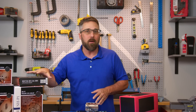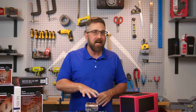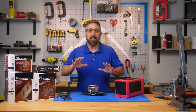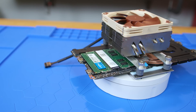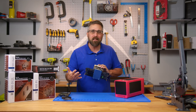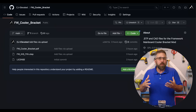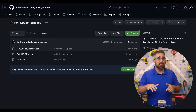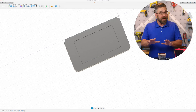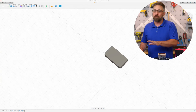If the temperature holds up well, that's what we'll be going with. In the long run, I might have the IHS I designed brought to life, but this solution is something anyone with a basic tool kit can pull off. I used 22-gauge steel for the backplate, but you could fashion it from practically anything — try 6–8mm acrylic; it's a breeze to work with. You'll find links to the blueprints and the CAD files for the IHS I designed in the description below. Note that the IHS is designed based on the 1165G7, so you might need to tweak it for other CPUs.